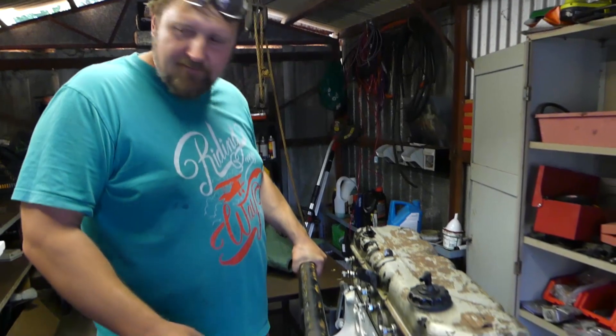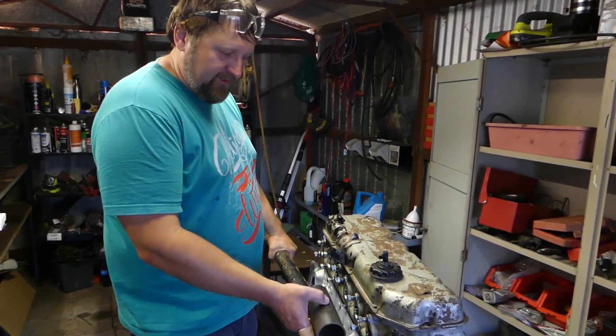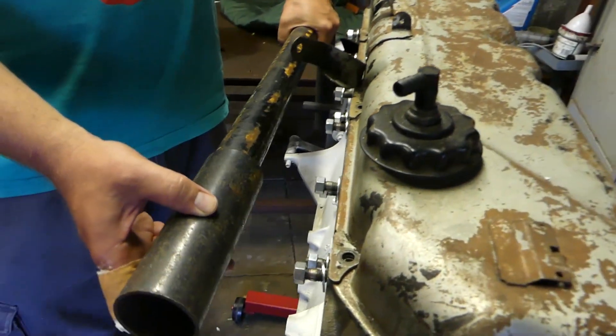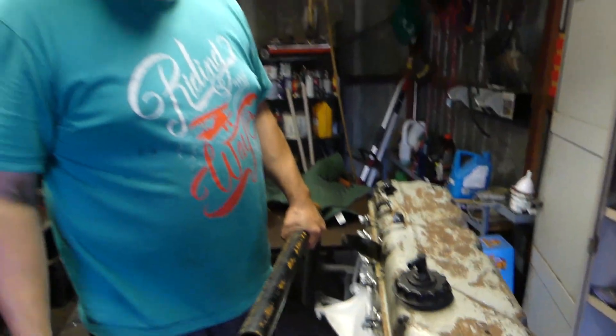The thinking is to have two sections. We have this larger one for the flange — this one will receive number one and number two cylinders — and then the rest of the four cylinders will receive in the thinner pipe, and then we're just gonna do straight runners into the laser-cut flange that we had already laying around for about six months.